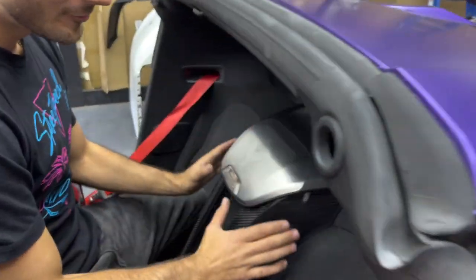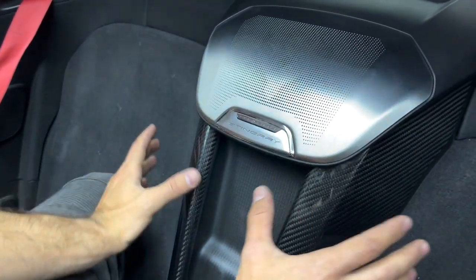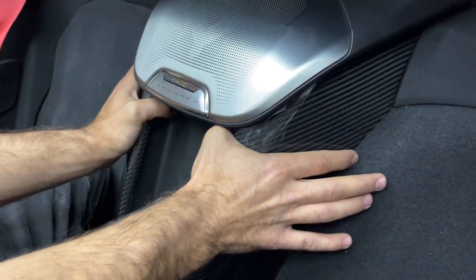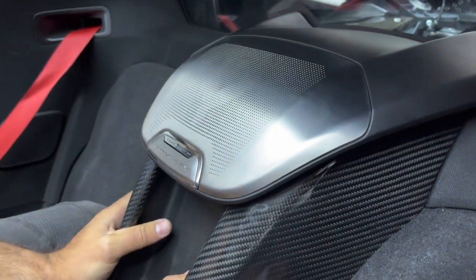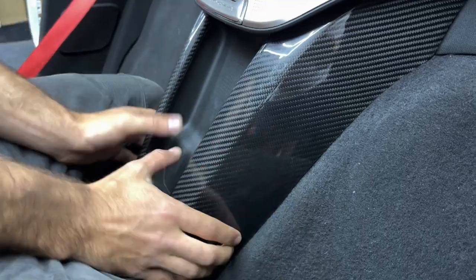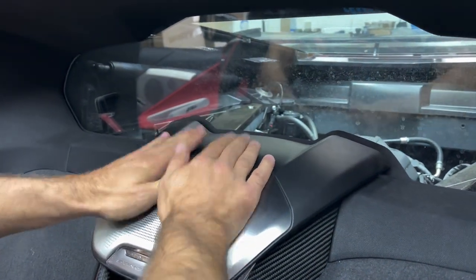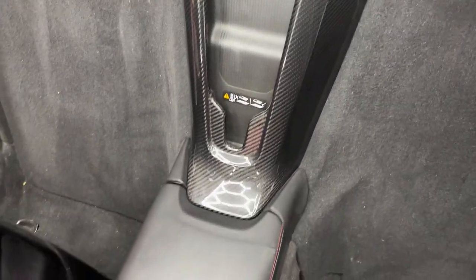Still needs to be seated down on the edges, fully lined up, and now we just apply some pressure. It helps to get fully inside here — appreciate the back seat of the C8 for that. Each side flexes a little bit because it is carbon fiber; it has some give to it. Spread it out and push her down on each side, push her in flush, wrap around the edges. Force it out to make sure everything sits correctly — looking beautiful. Fully seated down, I can put this top subwoofer piece back in; just clips in just like that, and we're good to go.